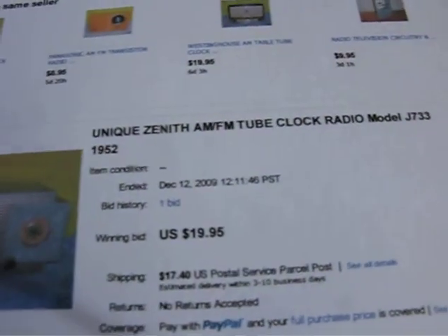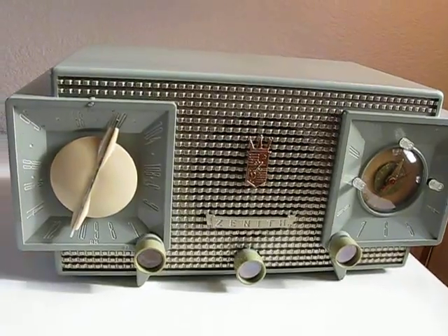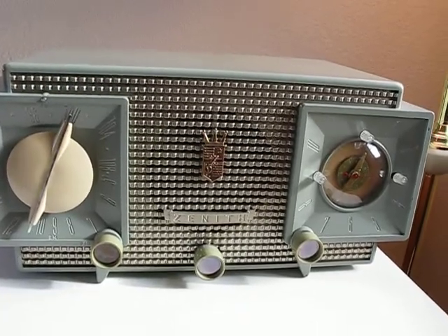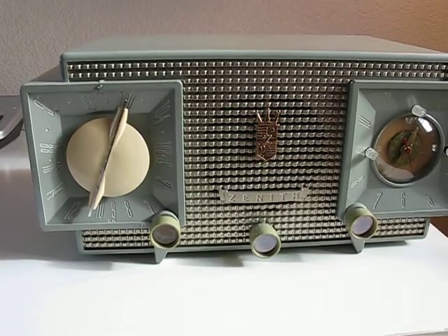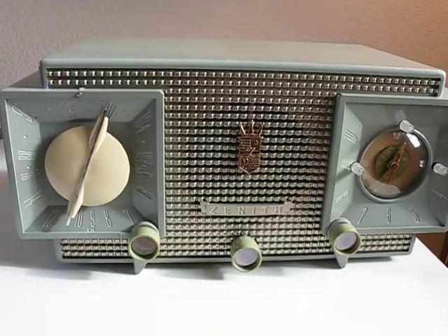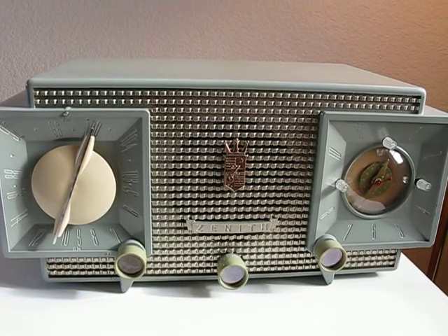I got a copy of the invoice here, which I thought was a pretty good deal. The listing had it that it worked, but when you turned it on there was a loud hum and no stations, though the clock did work. When I took it apart it had a lot of bad connections in it, the dial string was not working, and the tuning camshaft for the FM slug tuning was not right — the cam didn't open up all the way and needed some lubrication.